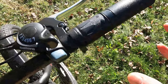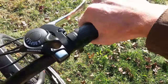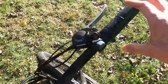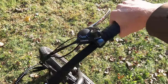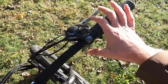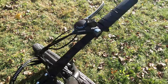On the right side, there's a right-hand twist grip throttle — one I haven't seen before, but it feels fine and gets the job done. One thing I want to point out is that the throttle and pedal assist don't play nicely together. For instance, if you're in pedal assist one pedaling along and you want more throttle, you won't feel that additional power until you actually stop pedaling — different from how most electric bikes handle it.